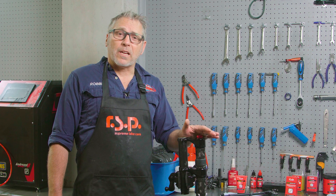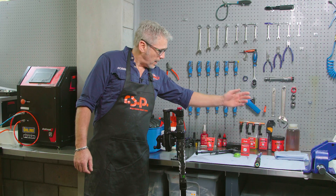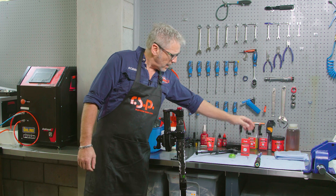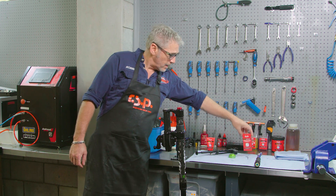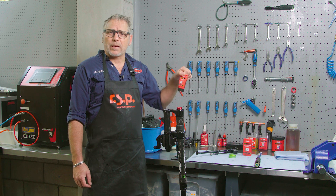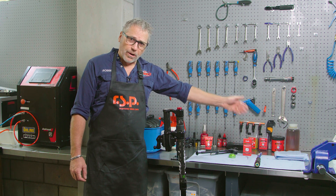The service can be done on or off the bike. Tools you're going to need are a torque wrench, a 2mm Allen key, a 36mm socket with 6 sides, and of course your RSP Lefty Service Kit. A decent shock pump, and I also like to use a little bit of grease when we put it back together — just grease the O-rings — and of course some lint-free rags.